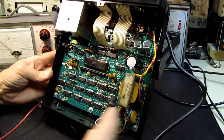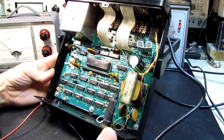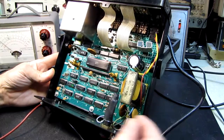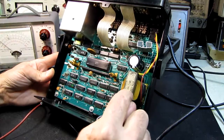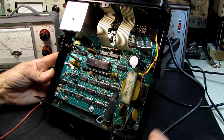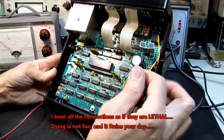There's 120 volts inside of these. Just because the logic runs on five volts does not mean there is not hazardous voltage. I've left the bottom cover on because the 120 volts goes into the printed circuit board, in the area of the transformer, and most likely up at this switch. They may be switching the secondary, they may be switching the primary — I don't know, I didn't check.